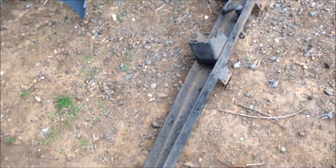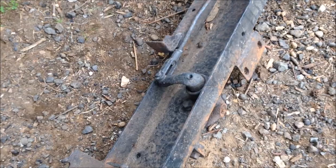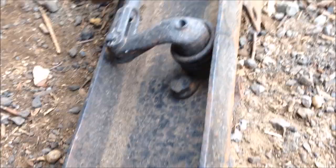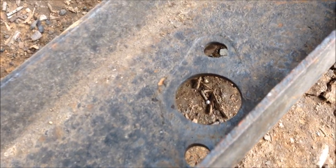Tucked in behind my top workbench in the top shed is a reconditioned set of rear brakes. Perfect. The chassis is early 1928, and how I know that, it has the handbrake mounted to the chassis rail on the left-hand side. It was a left-hand drive car, and how I know that, we'll do that to start with. So that's where your steering box mounts.